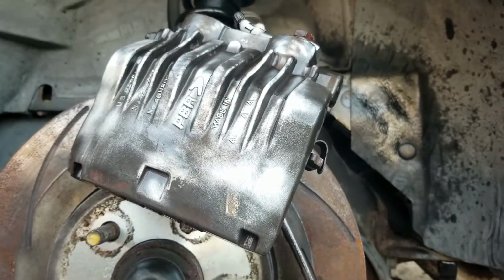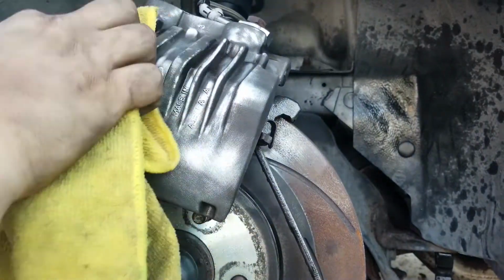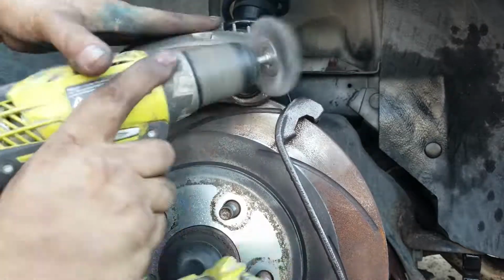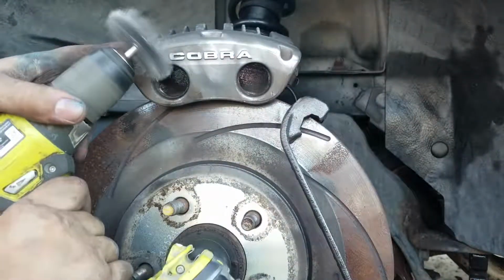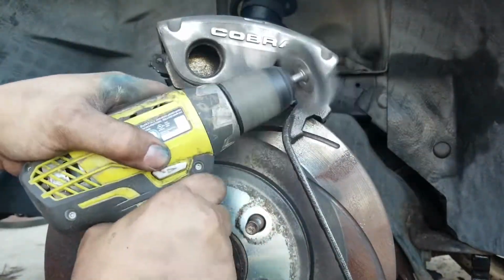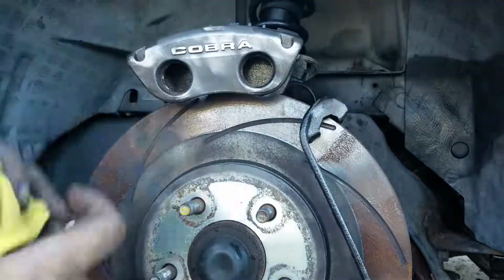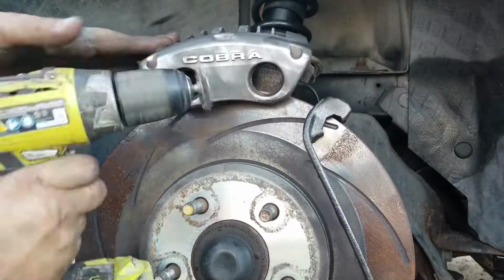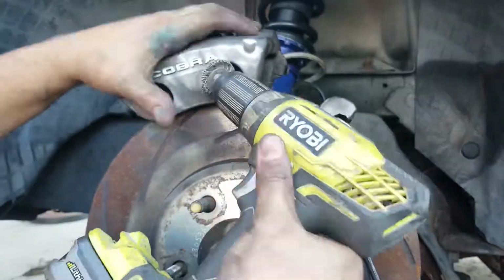And this part I kind of did off camera, but you might see that the brake caliper looks a little bit more wet. What I did here is that I sprayed some isopropyl alcohol. I think it's about 70%. I don't think it'll make much difference whether it's 90 or 70%, just due to the fact that this is pretty much metal. So it's not going to do any damage if you go higher as far as the percentage. And what I did here is just to clean off any loose metal fragments or any loose dirt that might be on there.